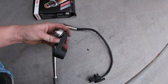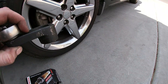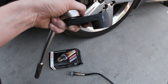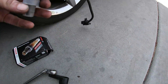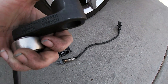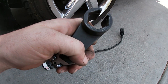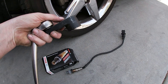I wound up getting this socket to fit up in there so I can get it angled — it sits in about like that and you're able to actually get some leverage on it with a long reach to crack that sucker loose. It sits down in the exhaust and the heat shield comes up a little bit, so a flat style won't work. If it was the extended one that comes out a little bit it would have made my life a whole lot easier, but it still worked — I just had about half a turn that I could get on there, but I was able to crack it loose and bring it out.